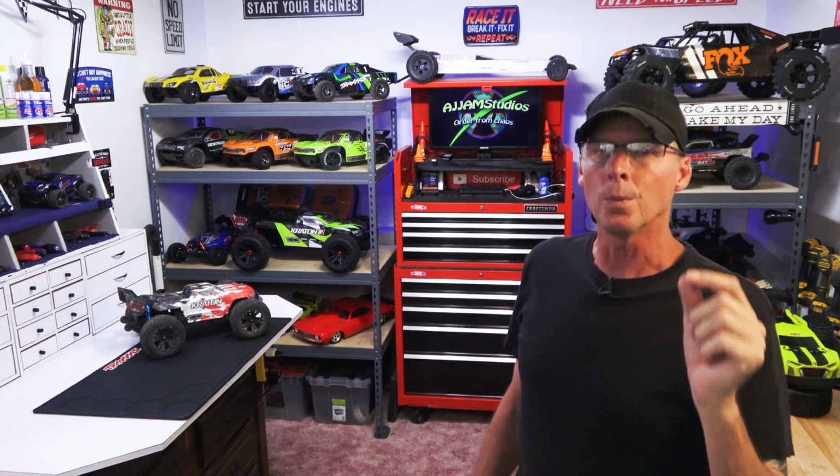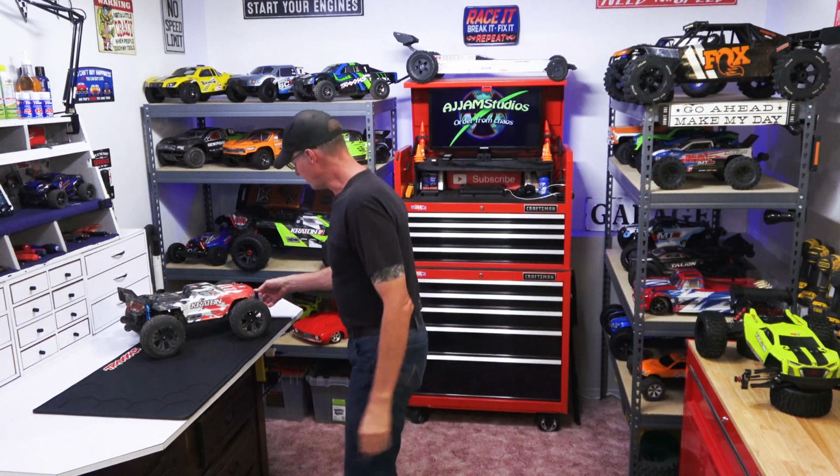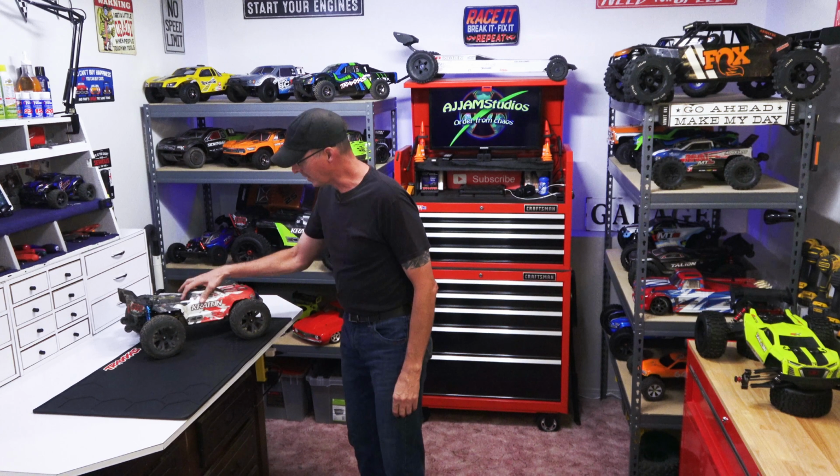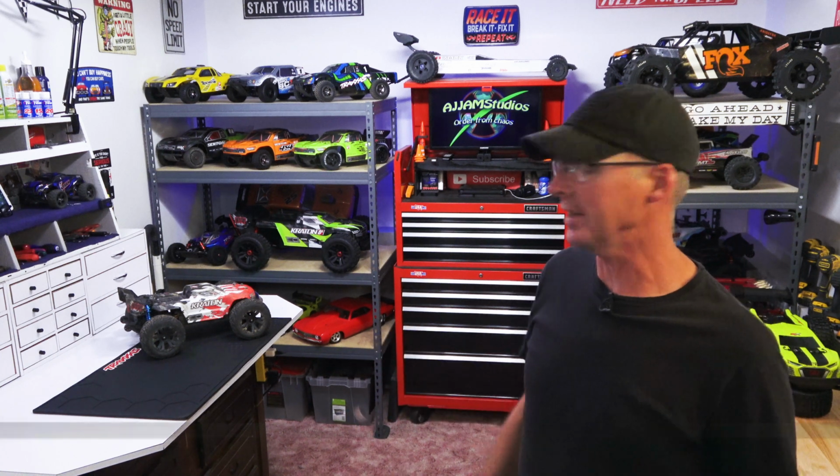In this video we've done an upgrade to it that needs to be adjusted, and so we changed out the shocks. We put some big bore shocks on it, but the fluid is pretty light, so we're going to go ahead and adjust the fluid. We're going to bring it up a little bit, try to make it a little bit stiffer. We don't want it really stiff, it'll ride like a board, so we're going to stiffen it up some so it still feels the ground, but it's not spongy the way it is.